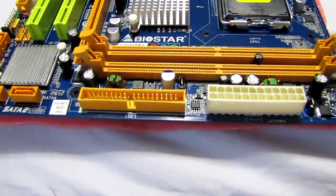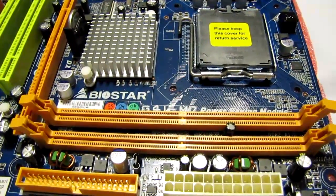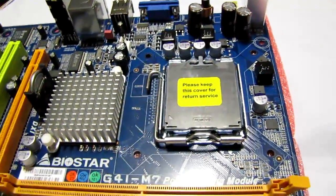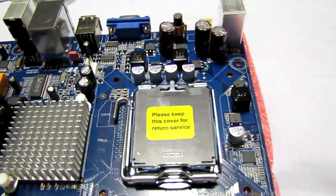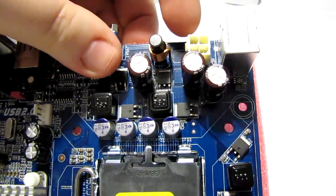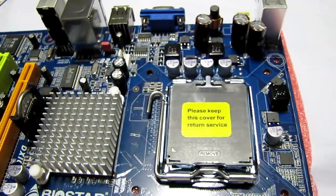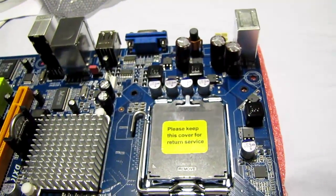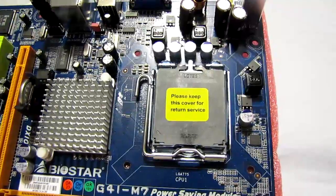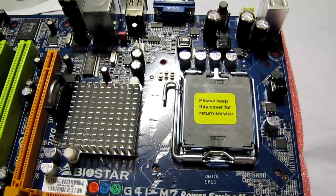It's nice to have the option should you need it. There's a 24-pin ATX power connector, two DDR2 memory slots supporting up to 1333 MHz chips, the CPU socket — LGA775 — and a 4-pin EPS 12-volt auxiliary power connector for the CPU. Without that plugged in, your board will not boot in most cases. The power regulation circuitry is a meager three-phase design. This is a very low-end board — it came free with a CPU combo, so that ought to tell you something.